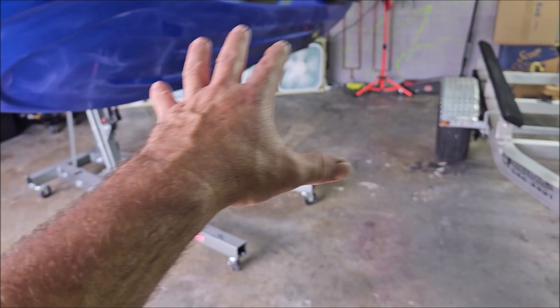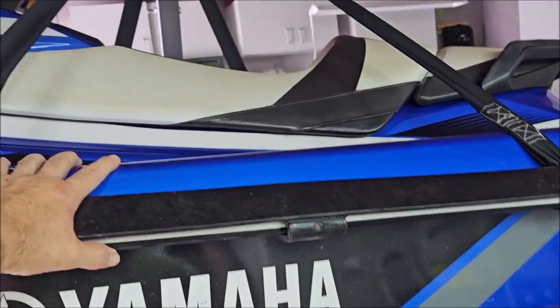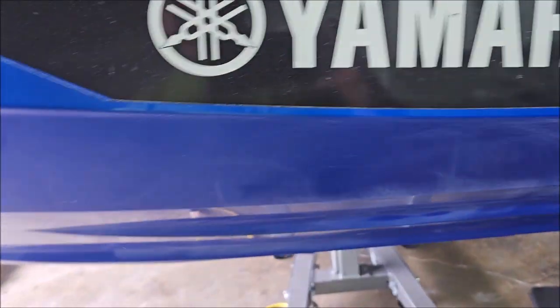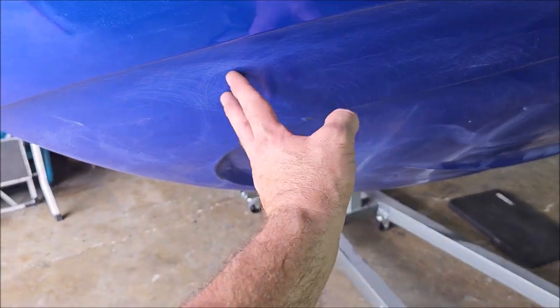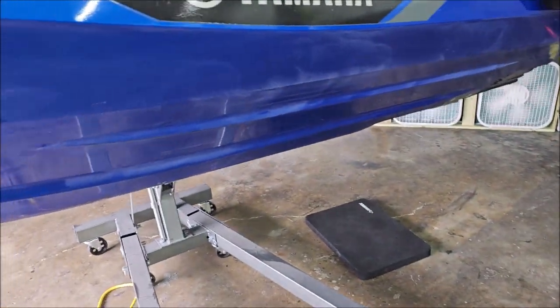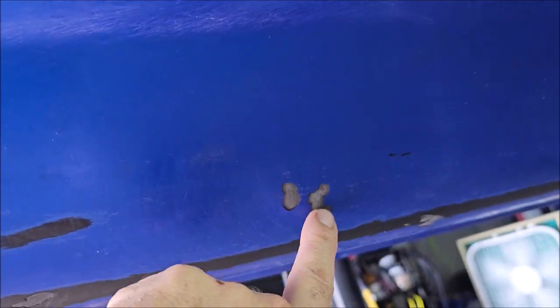We pull the trailer in, we get the engine hoist over here, we lift the ski off the trailer, make sure it's all secure, and be as comfortable and as careful around the situation as you can. I'm going to be applying my Versaliner in black and smooth from basically this body line down. This ski does have some chunks missing, but nothing seems to be coming apart, so I'm hoping I can get a good seal.